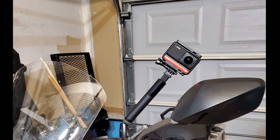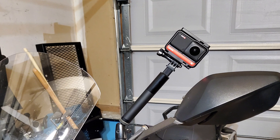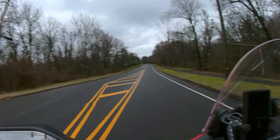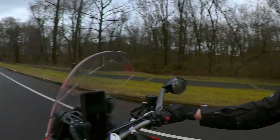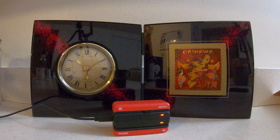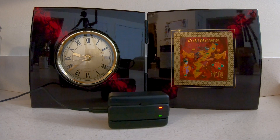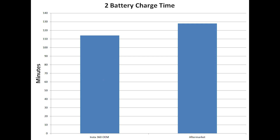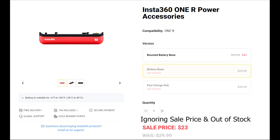When comparing battery performance, I had two batteries of both the OEM and the aftermarket fully charged and turned the camera on to record continuously under the same activity and temperature. There was a clear performance difference: the OEM continuously recorded on average for 66 minutes, and the aftermarket for only 50 minutes. As for charge time, I was really surprised — I did not expect a big difference in charging efficiency, however the aftermarket batteries took 12 to 14 minutes longer than the OEM to charge.